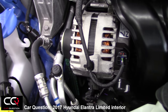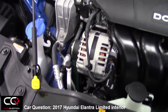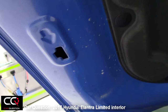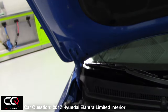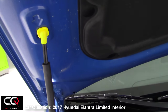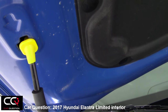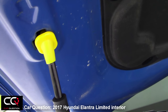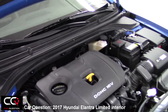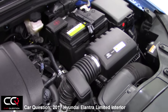The thing I need to show you is the hood prop bar — when you want to use it and plug it into the hood, it has a different shape than usual. I'll need to pause to show you properly since it's hard with one hand. If you put the bar in there and push the hood, normally it would pop out and you could pull it free. But you won't be able to do that here — you need to push the hood to the middle position and then move the bar sideways to remove it and close the hood. It'll be a little tricky for someone not used to that mechanism.